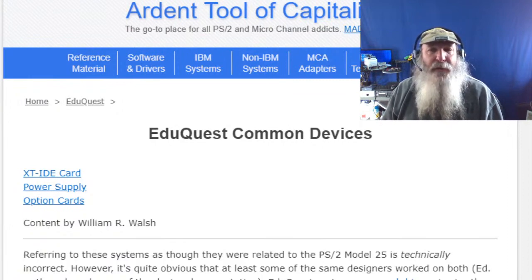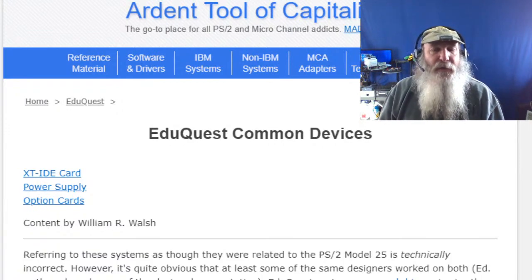Now, Seiko Epson had the other interesting aside, and it's a real tangent to this conversation. Of all the chips that IBM produced for VGA, all the chips that they had on their systems for VGA, there's only one IBM VGA adapter. All the other chips are on planars of the PS/2 systems for that VGA level. We're not talking about any later video standards or anything like that. For the VGA level on IBM systems, there's only one adapter that was made, and that's an 8-bit adapter, designed to go in the Model 30. You can use it on the XT and on the AT to add VGA capabilities to those systems, but it fits very well in the Model 30. And that has the IBM chip with the silver, the so-called silver cap chip.